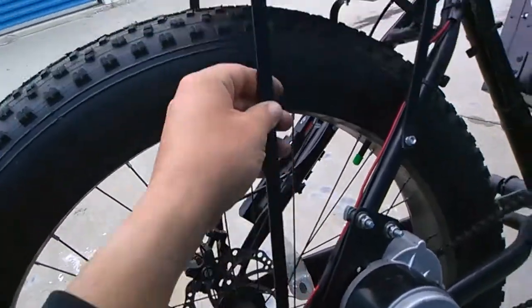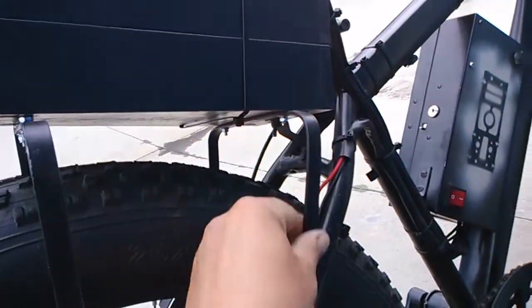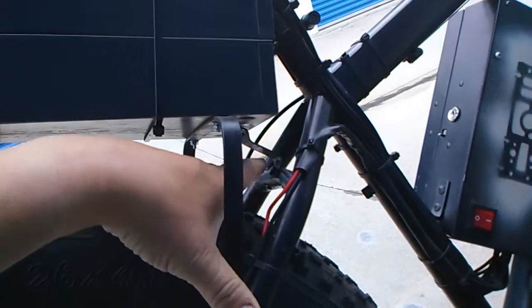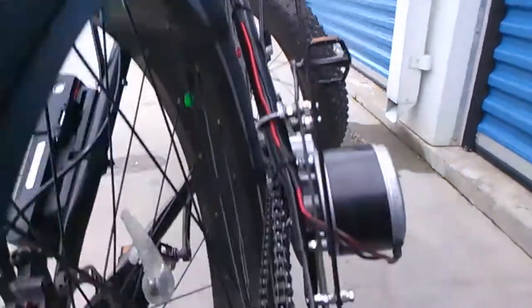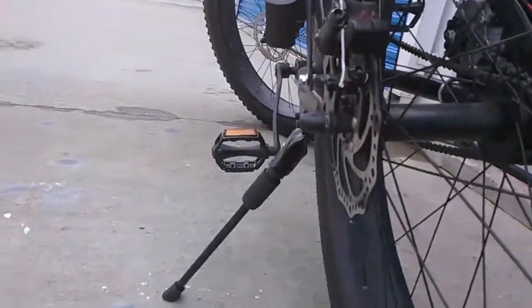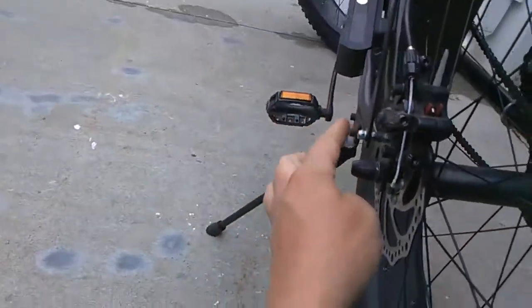I had to make custom metal stays to fit the battery boxes on either side of the bike. I have two at the front tapped right into the frame, and a third one in the back. On the motor side, you can put the bolt in the proper way and use three nuts as spacers. On the other side, I actually had to feed the bolt the opposite way — with the tire off — so the bolt head is on the inside, fed outward to get around the brake and secure the battery box stay.